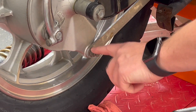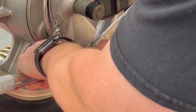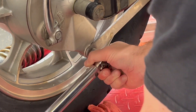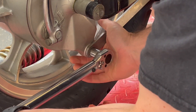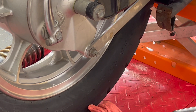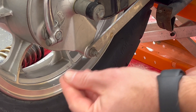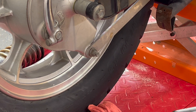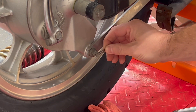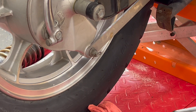We're back to the torque link rod — I call it the brake stay rod, but whatever. This is 22 foot pounds and that's a 14 millimeter. There's a hole in there and I was going to replace the cotter pin, but I decided I don't have any more and it's just a little surface rust on it. I'm going to go that direction — from the front to the back — and there we have it.